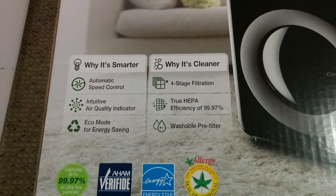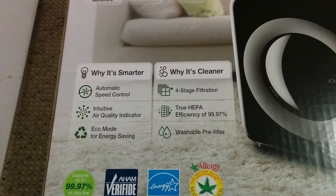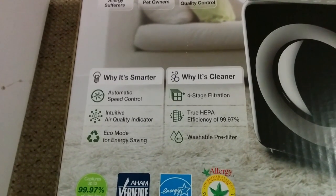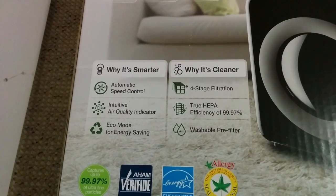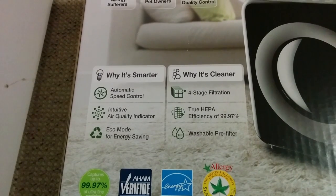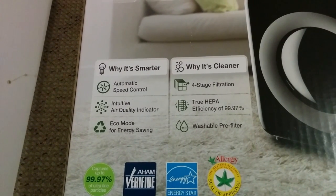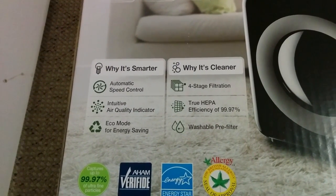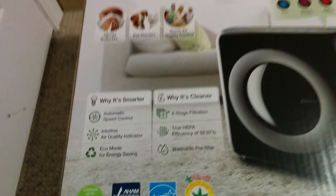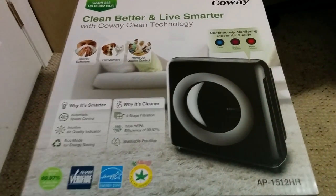With this HEPA filter, you're supposed to change it every 6 months to a year. With some units, I found you can get away with a little bit longer, but obviously you don't want to push it too much where it's not filtering as efficiently anymore. If I can get a year out of it, and from my research they're about $50 to $100 Canadian, that's not too bad. It's about standard. Some other units had little gimmicky things, like a 5-year filter instead of a year. I'm not sure how well those perform or if it's worthwhile, but even if you have to change it once a year, it's not that bad. You have to expect a certain level of maintenance and maintenance costs that go along with air purification. That's just a given.